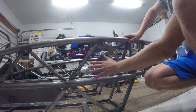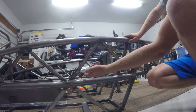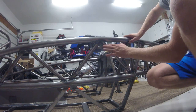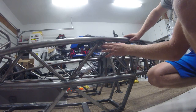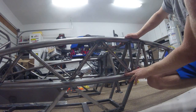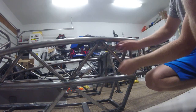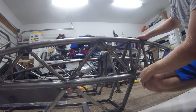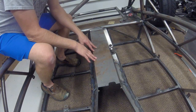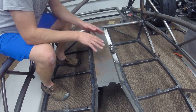I did a video on this for my Flying Miata front side panels. I went ahead and made these little tabs here, much like the stock tabs down below, and welded them on to give the same look that the lower mounting points have — same idea. Rather than using the two clamps that Flying Miata supplies, I made up some tabs and brackets instead.